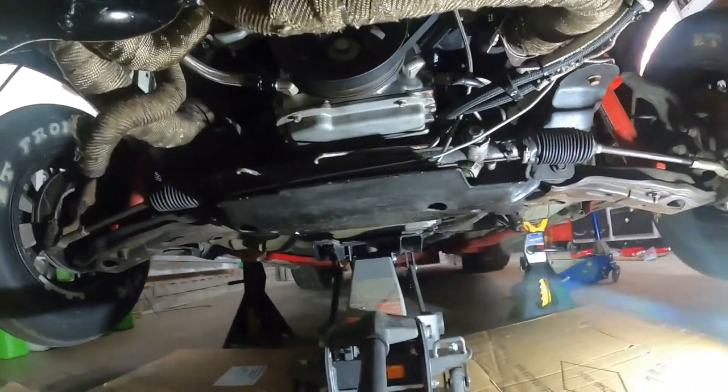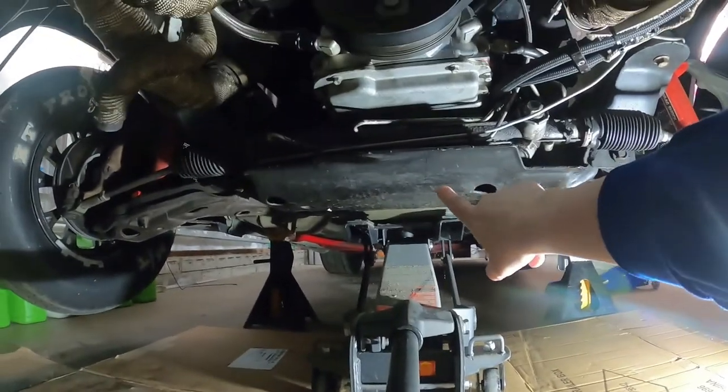And I'm getting ready to drop the LS1 K-member and the 4th gen lower A-arms that came on the car when it was still the V6 car. And I'm going to put a UMI tubular K-member on and Spohn Performance lower A-arms. So, follow along. All right, now this guy right here in the middle, this is what they call the K-member.